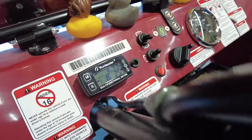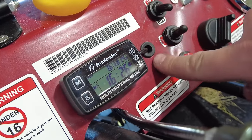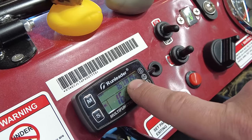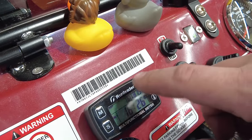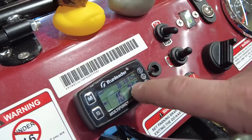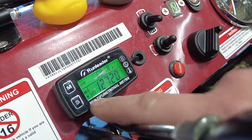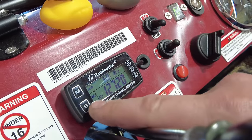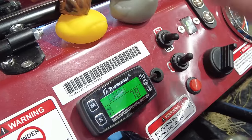We added a little tach. I'll leave links in the description for everything we used — the speedometer, the oil cooler, and this tach. I drilled a small hole, put a rubber grommet in, ran our wires, and plugged it in. It has a clock, it'll tell us our RPMs, our engine temperature, and total engine hours. It also has an engine temp and RPM limit where the whole screen will flash red when the engine temp reaches above what you set, or when the RPMs exceed your set maximum. It backlights green, and you can have it on, off, or auto — on auto it lights up when you touch a button.